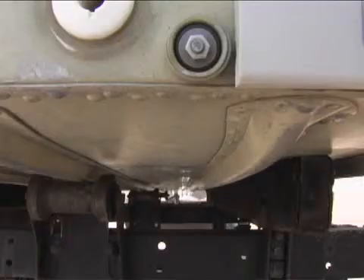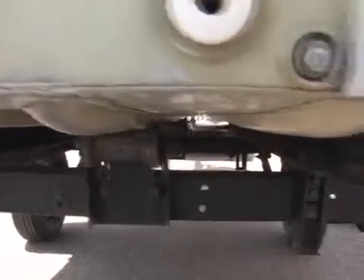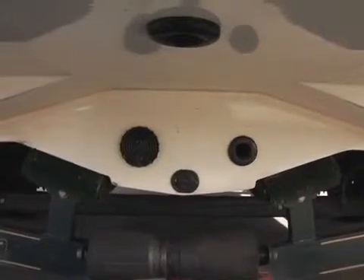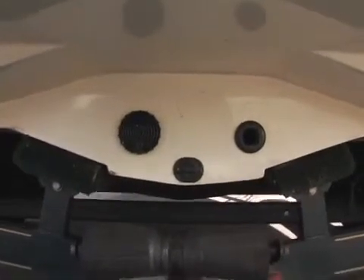The key to finding a good mounting spot is understanding the dynamics of how water flows under your hull at faster speeds. You'll need a spot where the water flow is smooth to maintain your depth reading at all speeds. Fiberglass boats often have a flat spot or pad at the very rear of the hull — this flat area is ideal for transducers, and getting a good clear reading at high speeds is fairly easy.